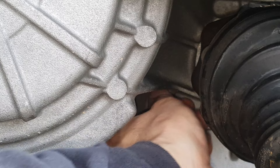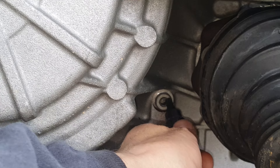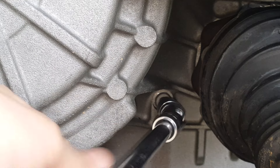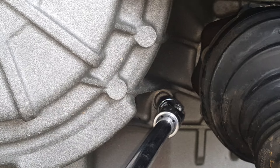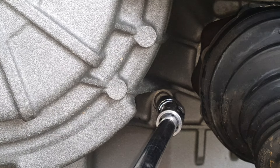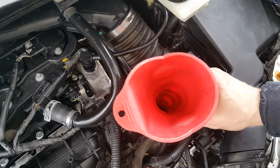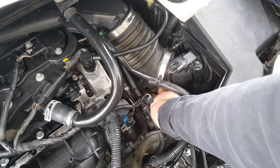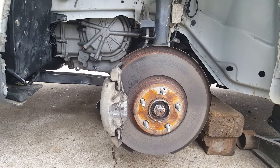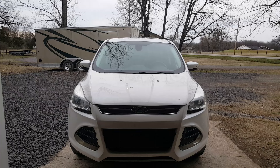This little Allen has an O-ring, so you don't have to worry about it leaking. It doesn't have to be terribly tight — it's just a little bitty bolt. Like I said, you could have a different one; I've seen them with bigger ones. I'm just going to snug this up with my three-eighths — that right there should be plenty good. So just that easy, and all we've got to do now is get our wheel back on.